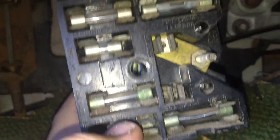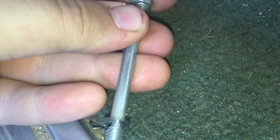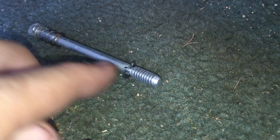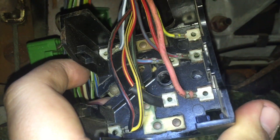Now to get this apart — that's what it'll look like, with the green part and the bolt right in the center where the threads come through to go into the firewall. That's where you initially take it off. The threads will pop through the back. There's a spring on the front, so you push the bolt and once the threads pop out a bit more in the back, there'll be an e-clip — just go ahead and take that clip off, then you'll be able to take the bolt completely out. Once the bolt's out, the back green piece will separate and you can access all the wires and clips really easy.